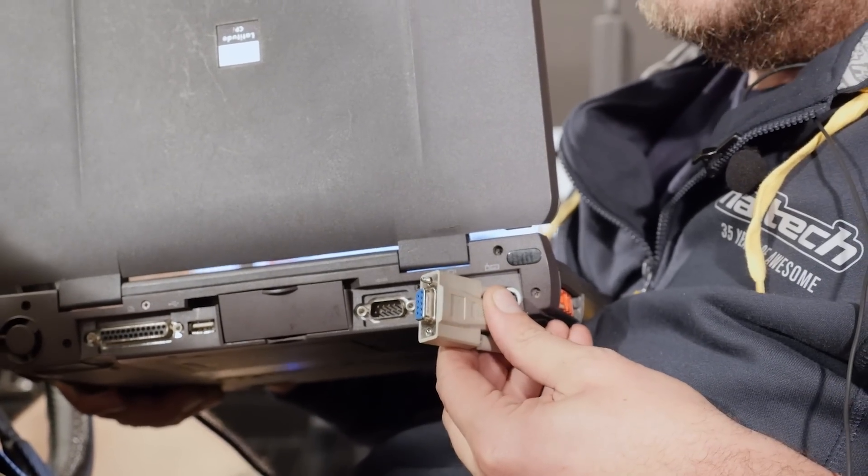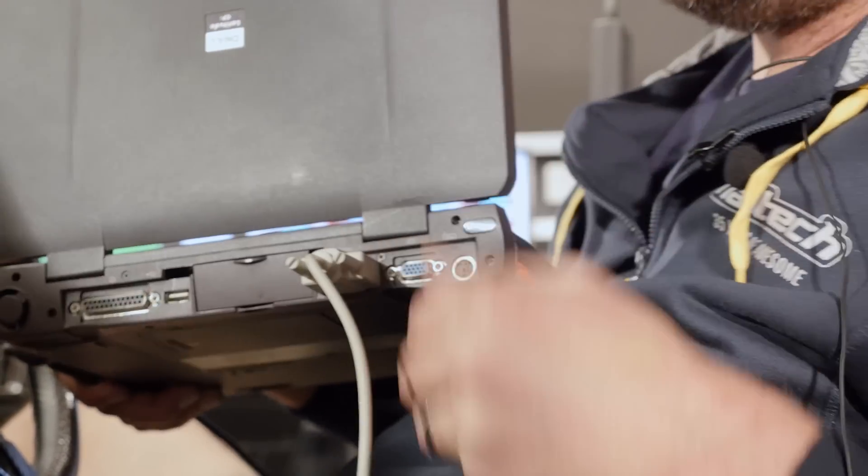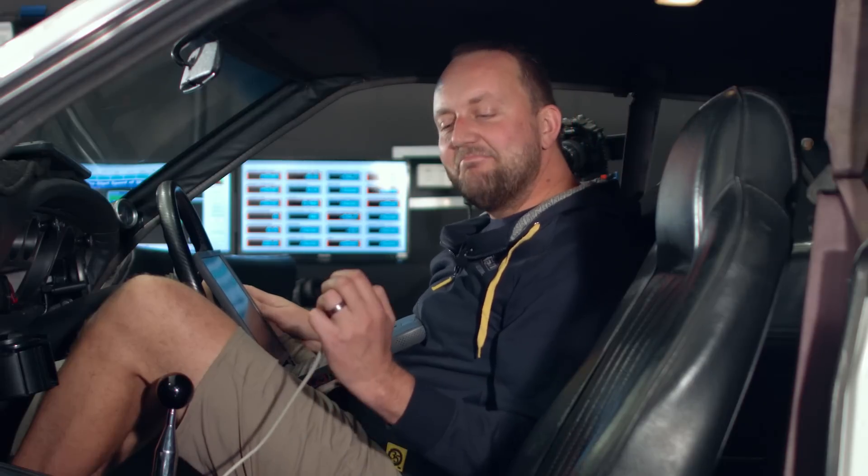The next complication is physically connecting the ECU to the computer. This thing has got what we call a DB9 or a serial connector. Anything that's been made in the last 15 years or so, it's all USB — the drivers are all available, you plug it in, Windows does the work and you're away. Not in this case. We need to plug this DB9 9-pin plug into the back of our laptop, go into the Haltech software, and configure which port and which speed it's going to be communicating with. You don't need to worry about any of this stuff anymore — all of this is a thing of the past, but it's pretty retro and pretty cool.